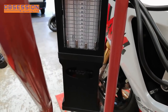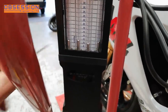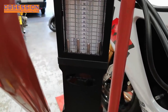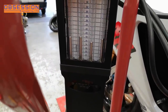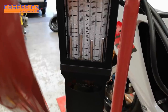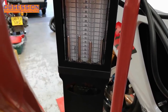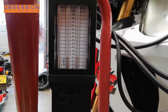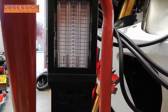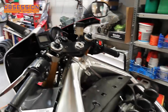You can see on the gauges that they're not massively uneven but there's a little bit of variation between them. So I'm going to go in and just tweak the throttle valves a little bit and see if I can get them to run correctly together, and then hopefully it won't do the thing of speeding up and slowing down on its own. After a few minutes of fiddling, that's about as close as I can get them — which according to the manual that comes with the carb tune is pretty darn good. That seems considerably better.